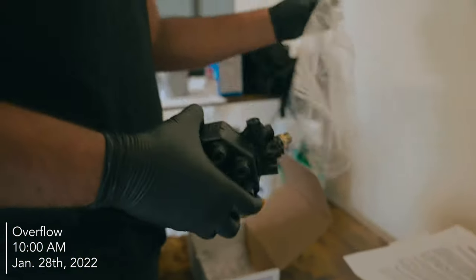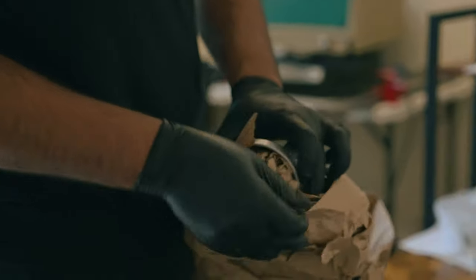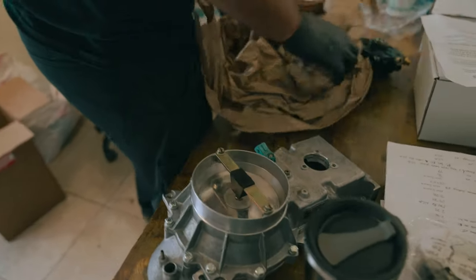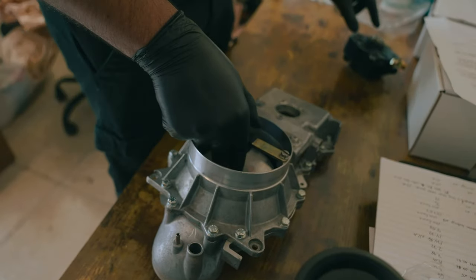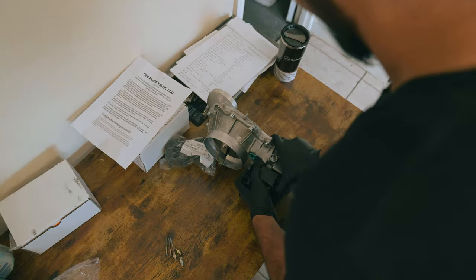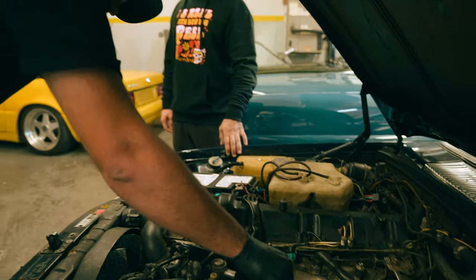This is the pin that was frozen solid — that's the airflow meter. As you can see, it's supposed to come all the way down, and as this comes down it pushes up on this, which pushes up on the fuel over here. That's how it works.